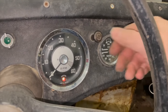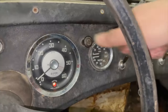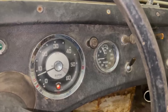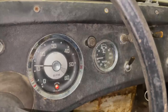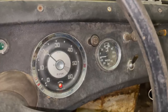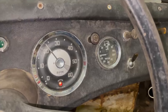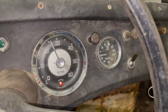With the oil pump primed, let's give this a go again. And there you go — we have oil pressure now. I'll let it pump oil and make sure it gets up all the galleries, gets to the top of the engine, and lubricates the valves. We definitely have an engine that we can work with here.